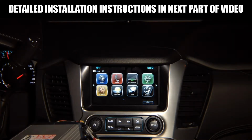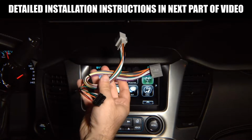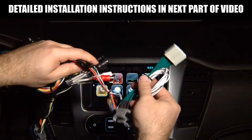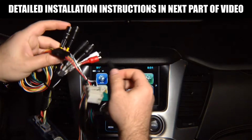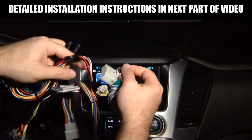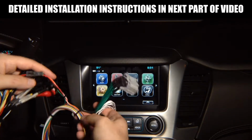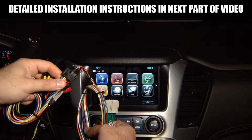Then you got this cable that's installed at the vehicle's radio module. You got this connector that plugs together with this, and this connects to the screen module. Then you got a second connector, we're going to show you all in detail, that connects to the radio module and has a single lead that's also on this same harness. You got single connector for this. So this has a long wire over here. You see that long wire? So you can install this at the radio module and route the long wire to the screen module and connect them together like this, because this cable connects to the screen module and then connects to the main interface harness.